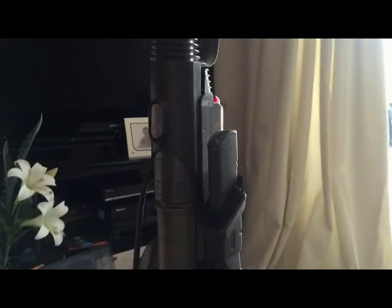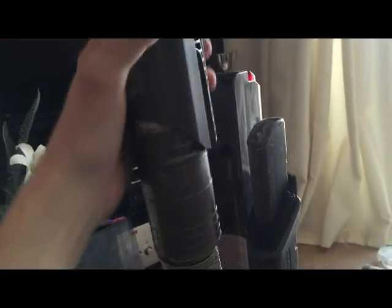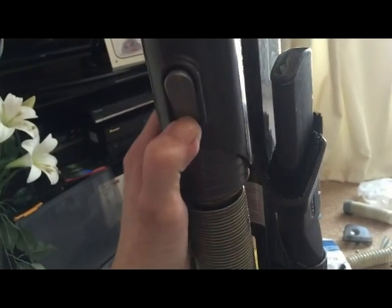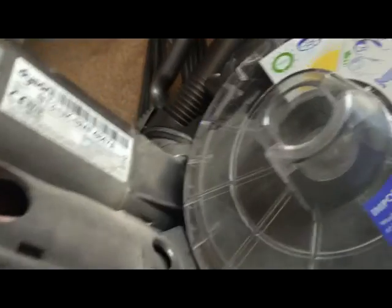My customer actually reported in this instance that the hose was damaged, so to lift the hose off this model, you just have to pull this bit out the top here and then press that, and that releases the bottom bit, and now that whole handle can come out. To release the actual hose off the bottom, just need to pull this little latch back here and lift.